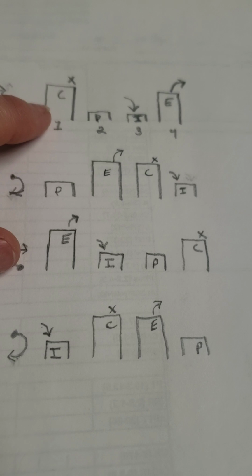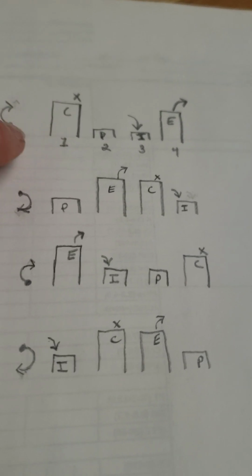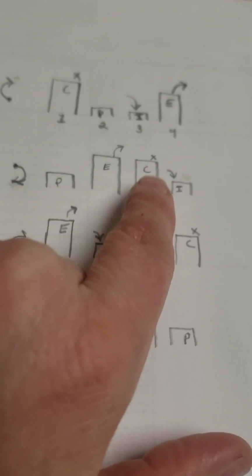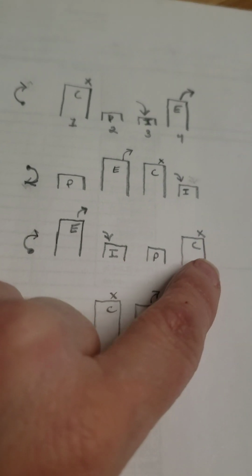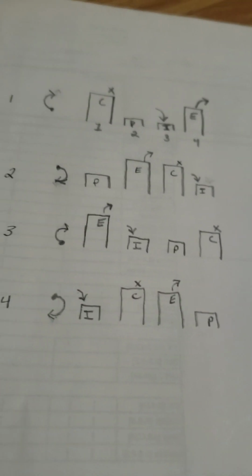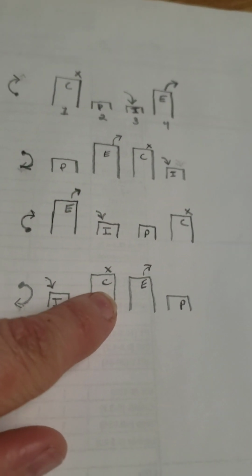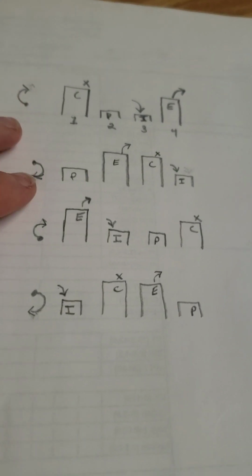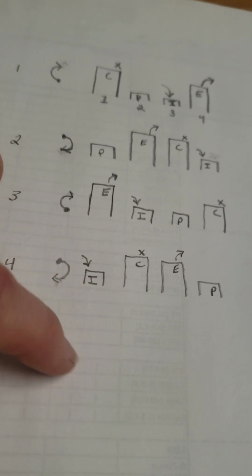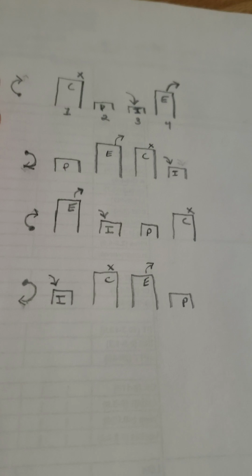So you find top dead center number 1 compression, do your test on that one, then you turn your crank half a turn, then go to cylinder number 3. That one will be on compression. Do your test there, another half a turn, go to cylinder 4. That one should be on compression. Another half a turn, go to cylinder 2. That should be compression, because the firing order for this engine is 1, 3, 4, 2. So if you do it in this order, you will have gone 2 full turns of your crank and gone through the whole 4 cycles in all 4 cylinders. And that's the fastest way to do it.